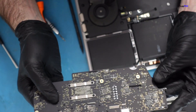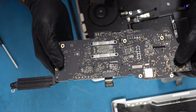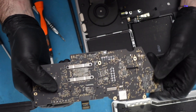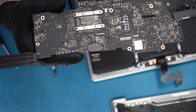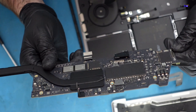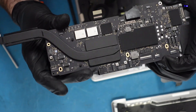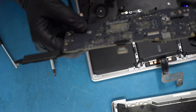I don't really see anything to my naked eye on the side of the board. Here are your two USB-C IC chips — the Texas Instruments CD3217B12. Those are your USB-C IC chips; if you have a problem with any USB-C issue, that's usually it, outside of obviously the port itself. This looks really clean. You can never trust your eyes alone for a repair — you always need a microscope, which we have here, so let's put it under.